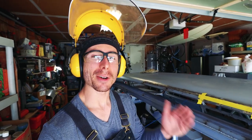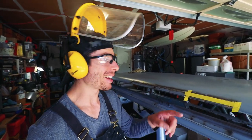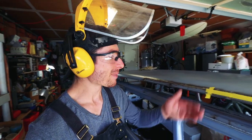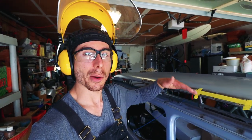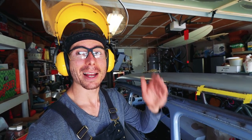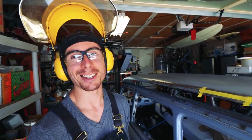It's the next day. I'm all geared up to make some cuts. Everything looks really good except for one small area that got bulged out a little bit — I think it's because I had to do two smaller patches in that area and the expansion and contraction during welding made it kind of wonky. So because I have plenty of patch material, I'm just going to make one longer patch to replace the lower half of those two small patches. I'll cut this out and replace it with a better piece, and it'll keep its shape and we'll have a nice straight drip rail.